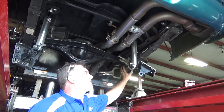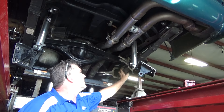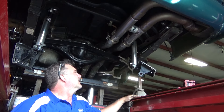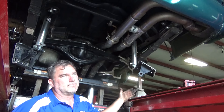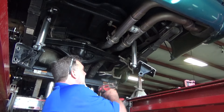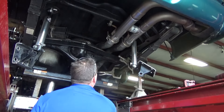So this has two three-degree shims in it — at least it appears to be two three-degree shims — and I'm putting them in so that they're neutral. That'll give me the angle that the axle sits at and it'll still maintain the ride height where it's at. If we need to modify it, we can take it three degrees down or three degrees up with these shims depending on how we put them in, and I don't have to take it completely apart, which is a bonus.